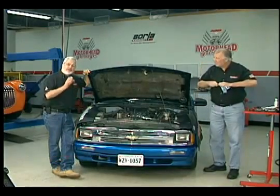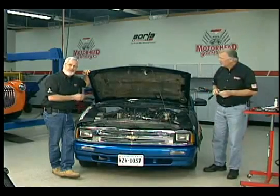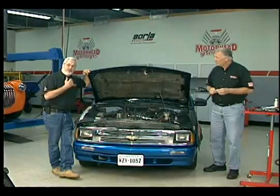We pulled the spark plugs out. First thing you want to do is keep them in order and read the plugs. The thing's consuming a little oil, has a little smoke, you know, valve stem oil seals, a little wear in the rings. So we want to do something to try to revitalize it.